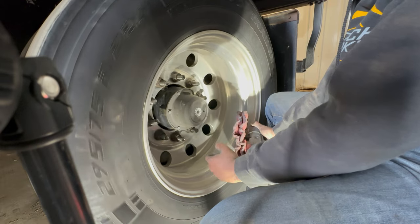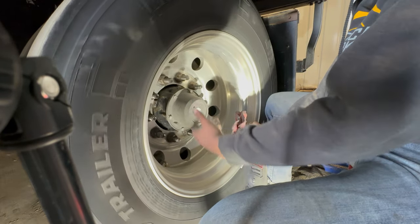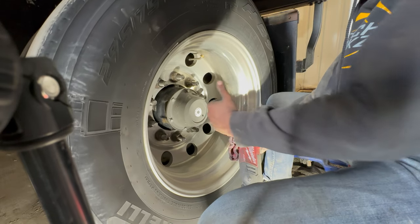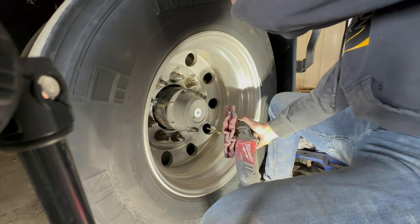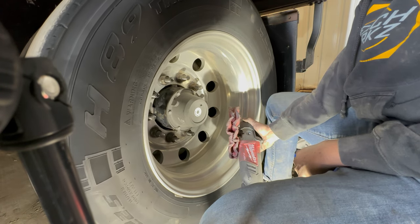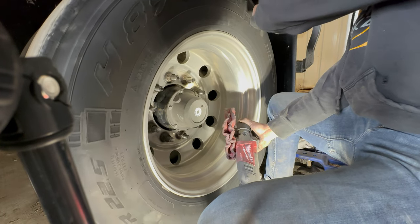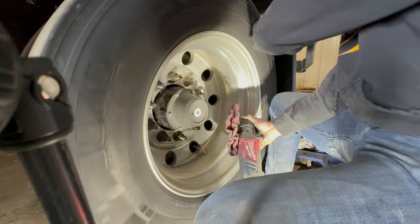and that's your guideline, as I call it, and you'll follow that in. So you'll go a couple rotations and then you'll push in just a little bit, go a couple rotations and push in a little bit, so your guideline will move, and that's how you know where you have polished and where you haven't polished. So I'm gonna start sanding this, and I will keep the video going the same speed it is now for a little while, and then I'll speed it up to a time lapse until we're ready to start polishing.